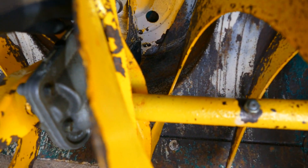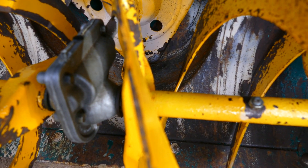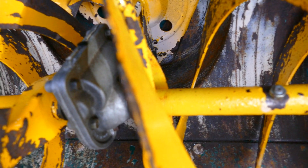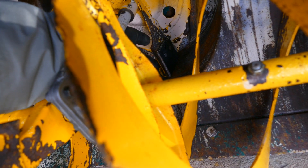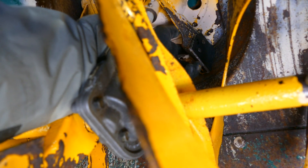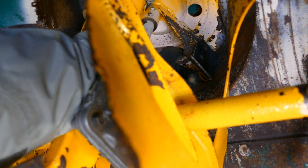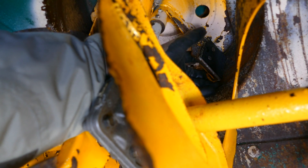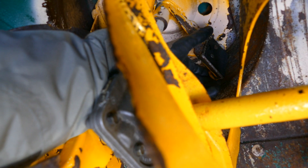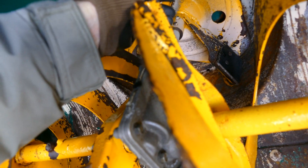There are two reasons why it works so well. The first reason is when they manufacture snowblowers, they don't want these metal structures, these paddles, hitting the barrel of the snowblower. So where my finger is, there's like half an inch of clearance between the paddle and the barrel. What happens is, if you don't have these rubber pieces on, the snow goes in between that half inch gap and it's not pulled into the chute to be discharged.